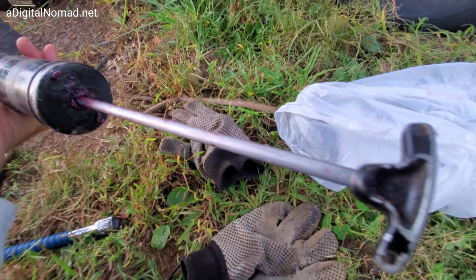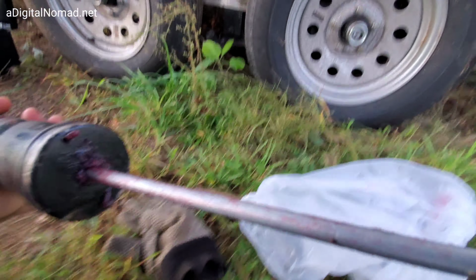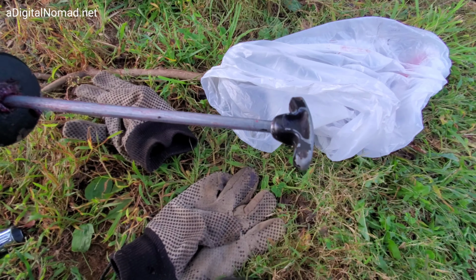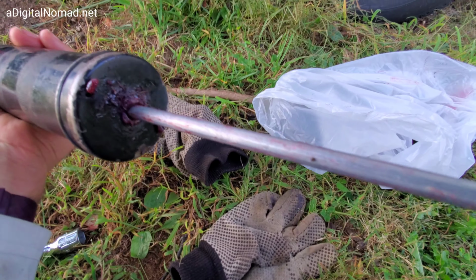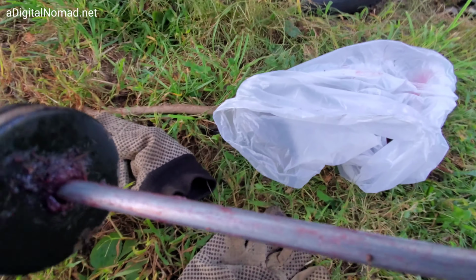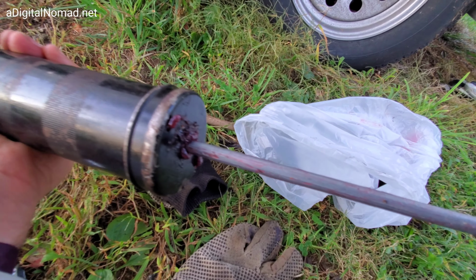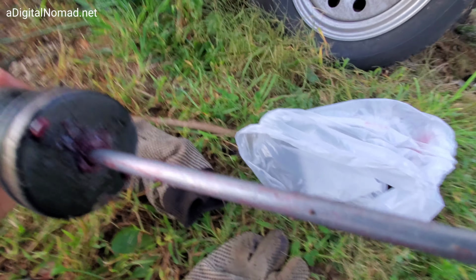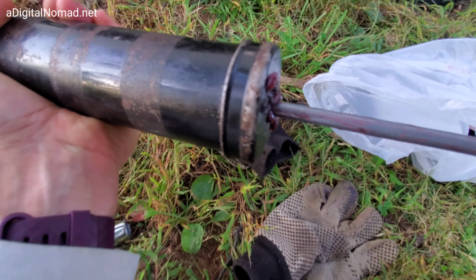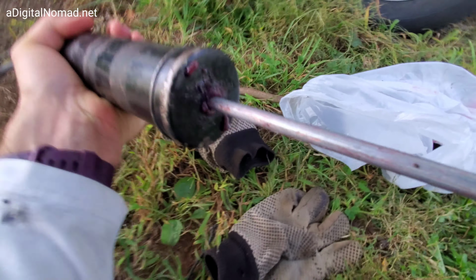All right, I already moved it. I got it so I can just push it in here, I think, now. And actually, yeah, it's not gonna go, but so far, it'll go a little ways, and then basically you're preloading the tension in here, you're pushing all the grease. You're packing the grease in. So push it down as far as it'll go without twisting it too far, because if you twist it again, internally it'll release and then it won't create pressure on the grease. You want to preload the gun by creating pressure, if this makes sense, right? Creating pressure inside there.